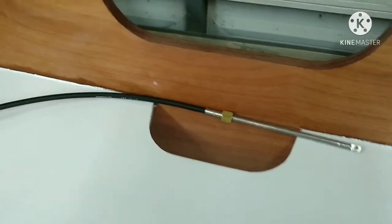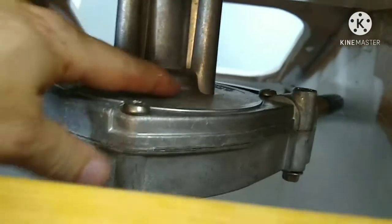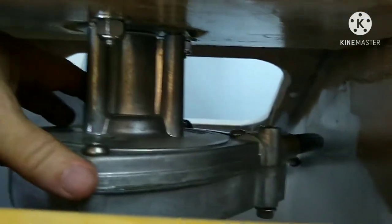Okay, so after, you know, some wrestling around with this cable, which routes down underneath the seat here, and then up in the corner of this cabinet, this is where the excess steering cable goes as you turn the steering wheel. And let me go from up top. You can see I've got this at just one angle set of holes from the mounting point of this steering mechanism. And that routes the cables nicely on this side of the center console here, so we got plenty of space to reach on the inside and do all of the electronic switches and stuff, which is probably going to be next week or the week after.